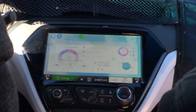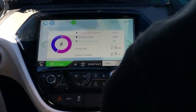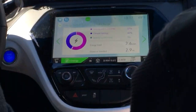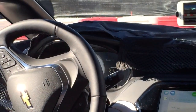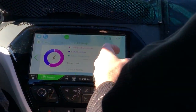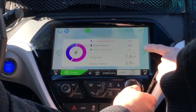We also have Energy settings. This is since last full charge. The battery is full right now — showing 20 bars, all green — that's the state of charge. This shows usage: what percentage was going towards driving and what was going towards other loads. You can see early in the day it was almost 50/50.